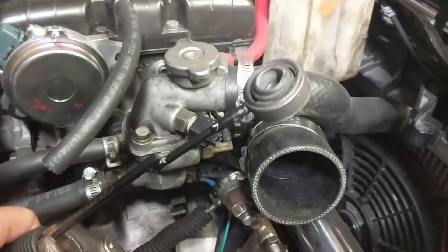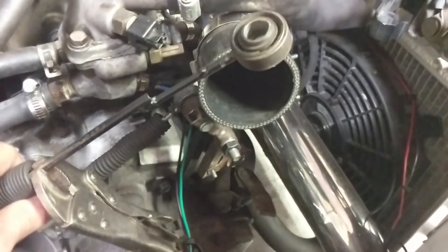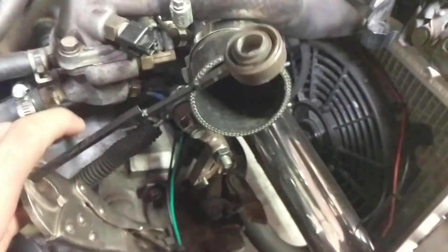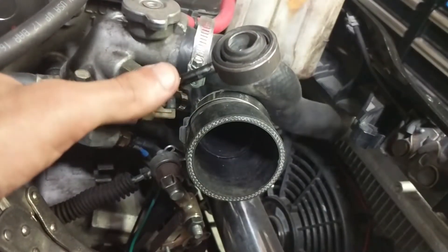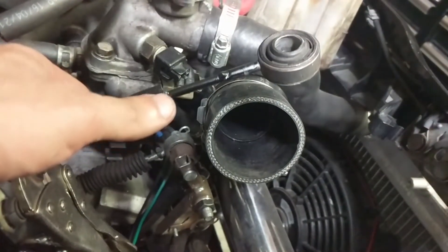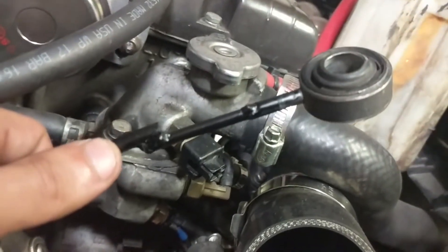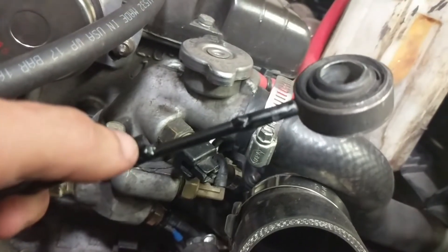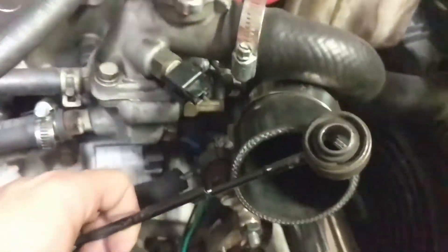So here's a little something that I did: because of the angle of the shift rod it would go really well into second gear, fourth gear, and reverse slots, but when you try to put it in first, third, or fifth it would kind of grind and be very difficult to get in. That's because the angle didn't allow for optimum shifting with the L bracket. So we've actually extended our shift cable - took a similar piece of steel rod, chopped up the old cable, and TIG welded an extension on there. We TIG welded it in a stair step for two reasons: one, it wasn't exactly the right length, and two, the offset was a little bit off. It puts a lot more stress on the cable if you weld it straight and then bend it, so instead we gave it that little notch. Now it's ready to go back in.